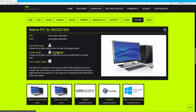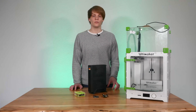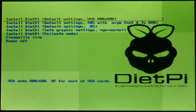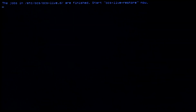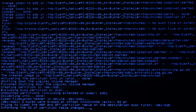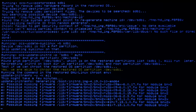Next, I downloaded an installer image of DietPi for native PC for BIOS/CSM and created a bootable USB stick with Balena Etcher, then installed DietPi on the thin client. I also tried using the direct flash image burned onto the SSD directly, but my system did not want to start. Also, during the first part of the installation process the system restarts, and after that you still need to enter some information with your keyboard. After the restart, the DisplayPort stops working and you need to use the DVI port, otherwise you won't get any output on your screen. Luckily I had a DVI to VGA adapter so I could connect it to my screen. Then the system will power down and the first part of the installation is done.